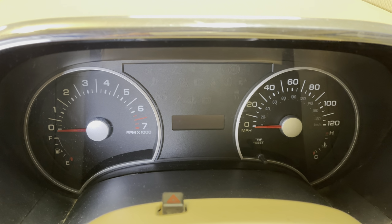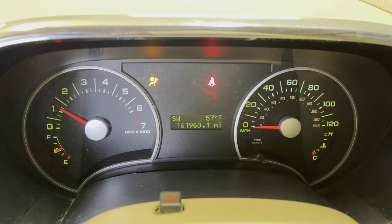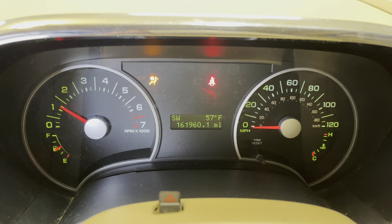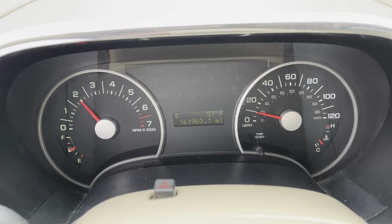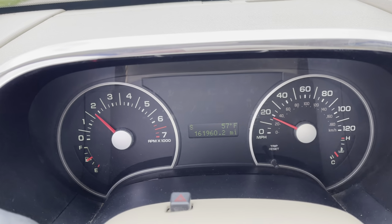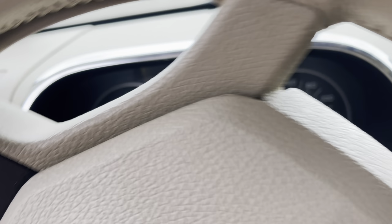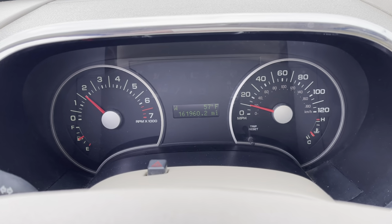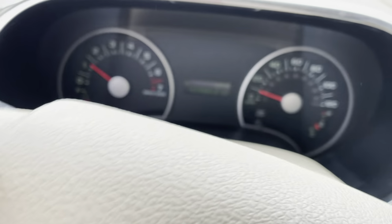We're going to take it for a quick drive. Make sure no ABS codes are set and no warning lights are on. ABS codes are usually set very quickly. So if you don't have any warning lights or any codes, once you hit 20 miles an hour or so, like you've seen here in this little short clip, you are most likely okay.